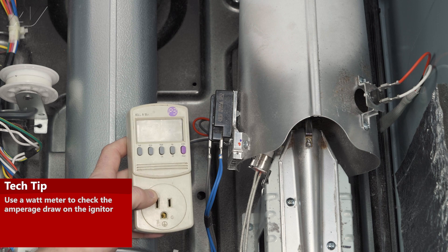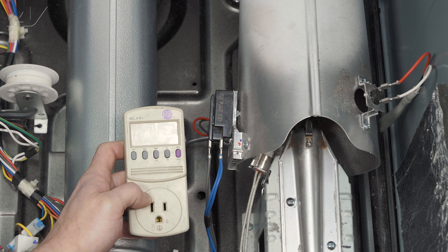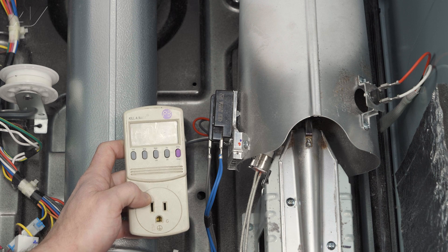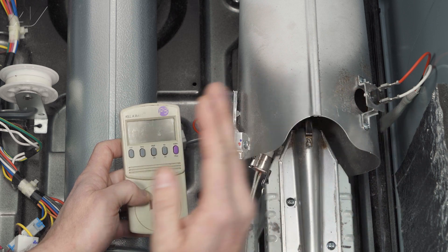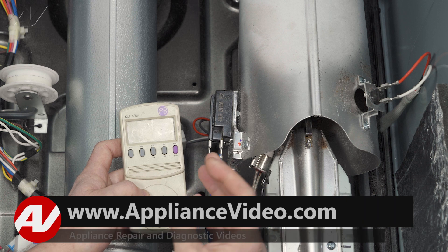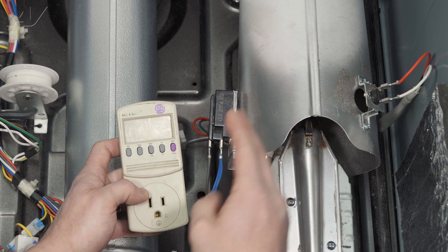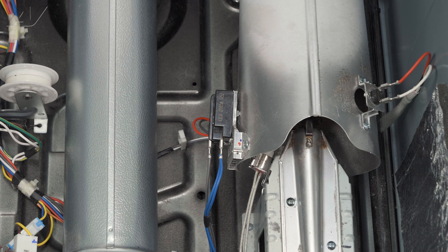What I like to use is called a kilowatt meter. When your unit is turning on, your general amp draw from this dryer will be anywhere from 3 to 4 amps. When your igniter glows, it will increase another 3 amps. When your flame sensor realizes that the igniter has glowed enough to release gas and combust, the flame sensor will open up the valve, let gas through, and your amp draw will lower down those 3 amps. To diagnose a bad flame sensor, I'll watch the 3 amps glow for the igniter — it will hold that 3 amps and stay roughly around 7 amps, never reducing or trying to heat. This means the flame sensor is not recognizing that the igniter is glowing bright enough to allow gas through. This is how I diagnose a bad flame sensor.